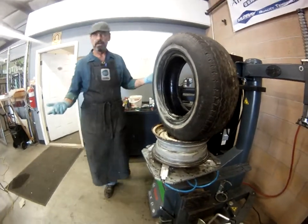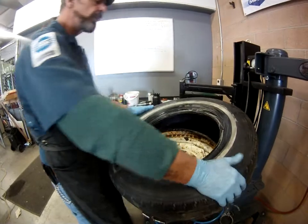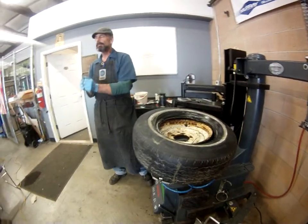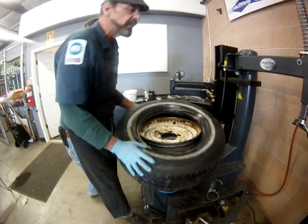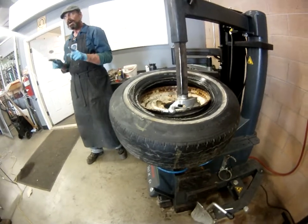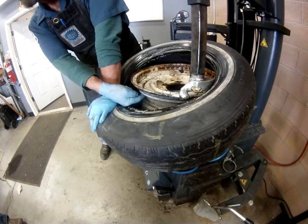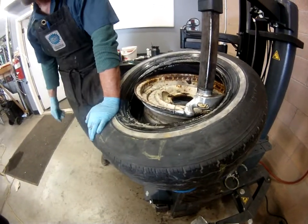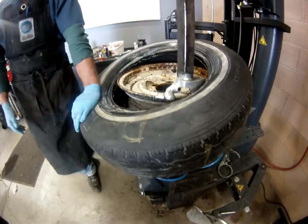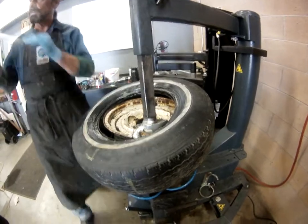For those of you who are stronger, you can actually put the inner part of the tire on without using the machine. All you've got to do is walk the tire on — it's push, push, push. You can pop the tire on by hand. I prefer to do that because it's faster, but if you can't, you've always got the duck head for both inner and outer parts. The real hard part is getting this bead into the center section. To do that — most people have the hardest time getting this to twist in — it's called slice and dice. We're going to slice it here and dice it right below the duck head and spin this bead into the center section of the rim. Slice and dice takes your hips pushing down on your left hand, pulling up on your right hand, and using your hip to throw that bead into the center section.